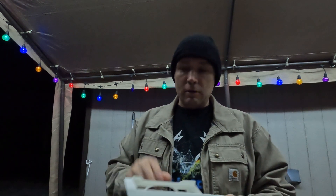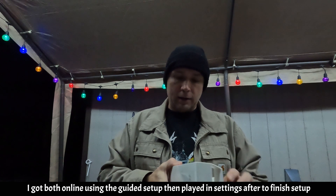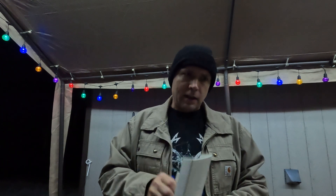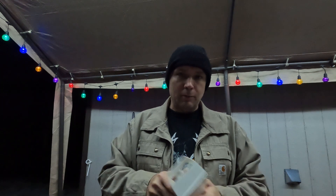These things are easy to configure. There's an option in the manual — I did read the manual, RTFM. For a straight point-to-point bridge, you configure the first one as AP and the second one as client. So I picked some IPs that were not used in my Starlink network, put one on the AP, configured just fine. Then I took the other one out of the box and went to configure it. It would not configure — I couldn't get past the user ID and password. Turns out, the certified refurbished unit didn't get reset. So with it powered on, I pressed and held the reset button for about nine seconds, the lights on the side flashed a couple times, factory reset done, and admin/admin worked just fine. I was then able to configure the TP-Link CPE without any issues and made the second one the client. Grand scheme of things, I spent maybe about 30 minutes getting these two configured.